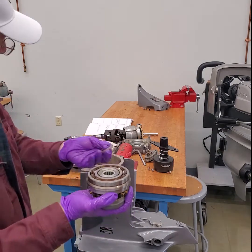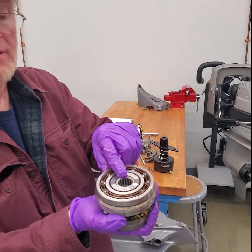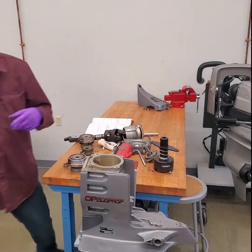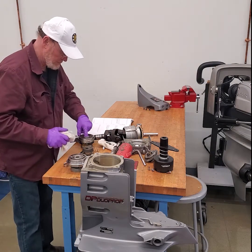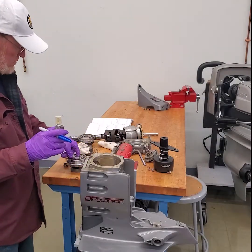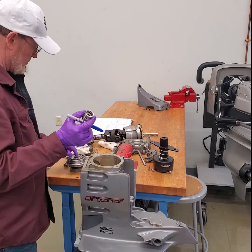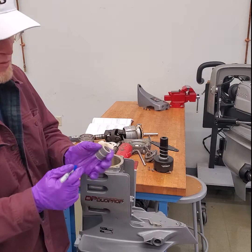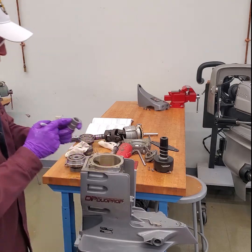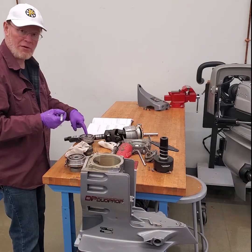It's going to require a new one. Now you have that retainer that has the groove in it for those keepers. This is the lower gear. The lower gear also has a bearing in it and that bearing needs to be marked. I'm going to do the same thing right now — I'll wipe that gear lube off a little bit on the top of it. There are two of these and they're identical. So if I forget which one they go in, I've got to buy new bearings. Don't put them back in if you don't know. So on the lower one I'm going to put another mark — now I have two marks, meaning two marks for the bearing is the lower gear.